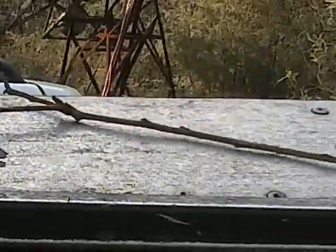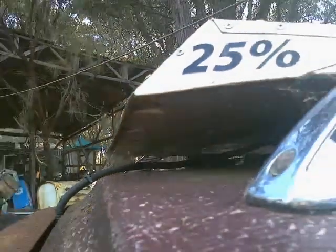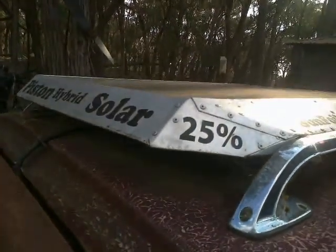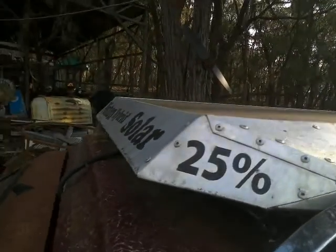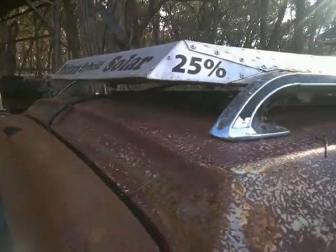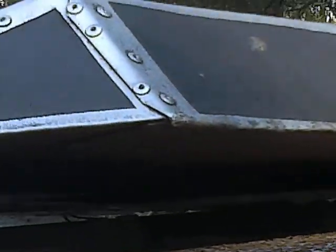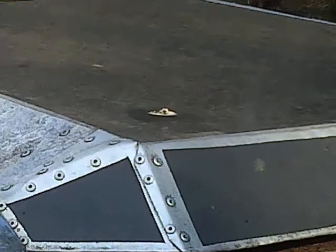It's fully enclosed, it's insulated, it's ventilated. It sucks cool air from the shady patch underneath with 16 forward-facing ram scoops, which at highway speed blow compressed air 20% faster than the car is travelling slipstream-wise, and 20% compressed onto the underside of the trailing edge. By Coanda effect, this draws air over the outside of the trailing edge, prevents it from stalling, and transforms the solar panel into a very high-tech, complicated aerofoil with boundary layer airflow control at highway speed.